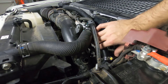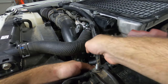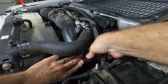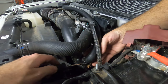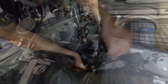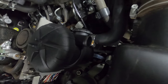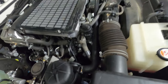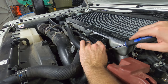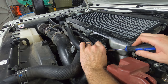The rain has come down again — hopefully you can still hear me. You loosen the factory clamp, lift that up, put the hose underneath it, and then slide it on, then tighten up that hose clamp. So the bottom hose is now connected — that's the hose coming from the air intake to the bottom of the catch can. We'll now do the top hose that goes to the crankcase. Just tightening up the hose that's going from the crankcase back to the top of the catch can.